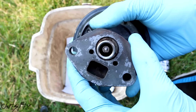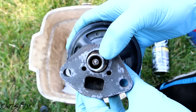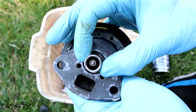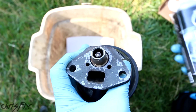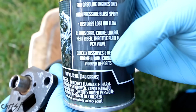Carbon buildup on your EGR valve will happen in two places. One, right in the valve itself — it won't close all the way, causing a giant vacuum leak. Or it'll clog the valve so much that there won't be enough vacuum to pull the diaphragm open. The other place is the valve stem, which has to slide smoothly — any carbon buildup might cause the EGR valve to stick open or closed. To do all the cleaning, we're going to be using a carb spray, which quickly dissolves and removes harmful gum, carbon, and varnish deposits.